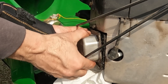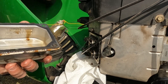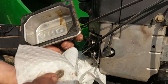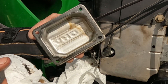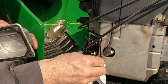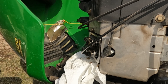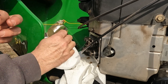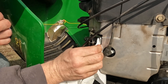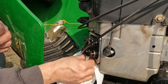There's very little oil in there but some. This gasket also came off intact completely, which is good news — I'm going to reuse these since they weren't leaking anyway. Wipe up the oil that's in there and clean off the mating surface well. Be careful — some of these edges might be sharp, so don't slice yourself.